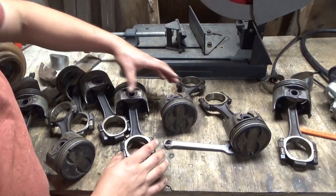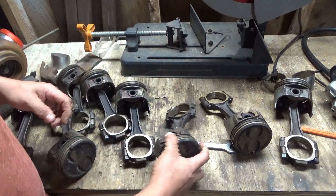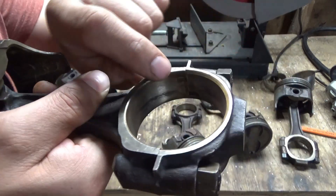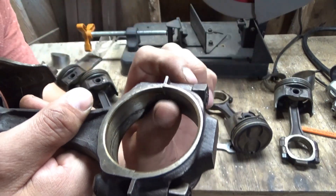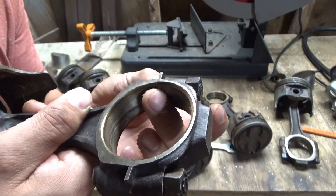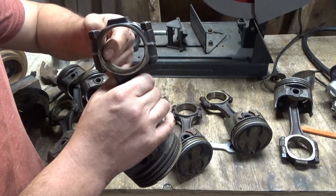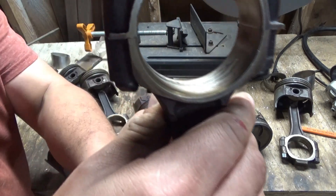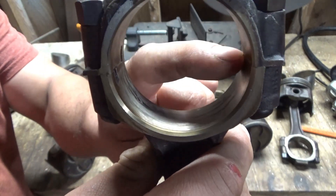Here's a problem I'm having with this engine. I forgot which ones it is, but these parts right here — this little bevel doesn't look like they line up. A lot of them are not smooth right here; they have like little ledges. This one's probably one of the smoother ones. Not sure if the camera could pick that up, but there's like a ledge right here.